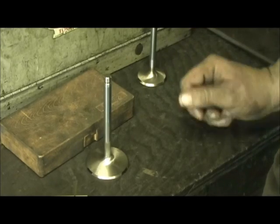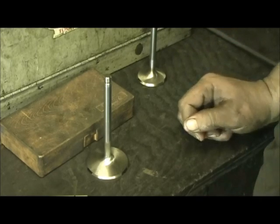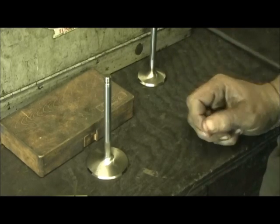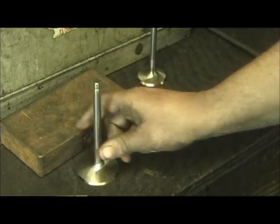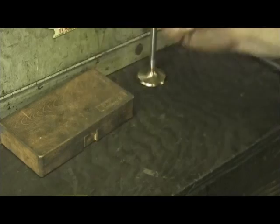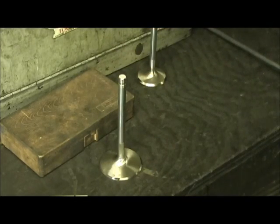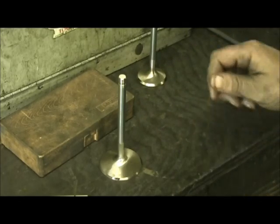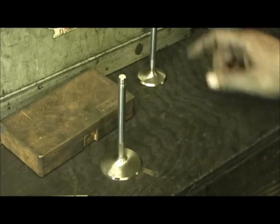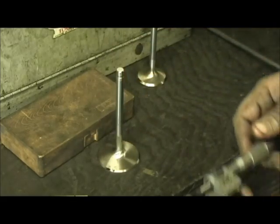If it's necessary, that's fine — I can live with 0.0001. But if it gets any more than three-tenths difference, three is the magic number. Three and up, I mark the valve and pick a hole to hone it and set it. In cylinder bores, most machine shops try to get two-tenths and below from top to bottom. I'm treating the valve guides the same way.